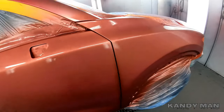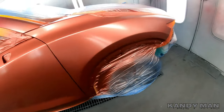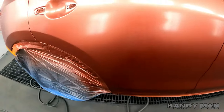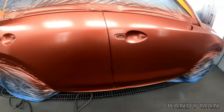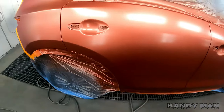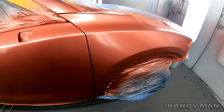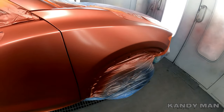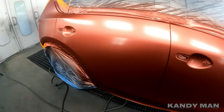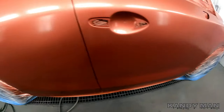It's not as crucial as a real UK candy but it will have the same characteristics if you get a little crazy with the gun. We got to walk this one out. Let it flash and we'll see where we're at. I'm using the 3M gun with a 1.2 in it for the ground coat — we put two back-to-back coats on it, checked it with the light, and it's covered. So we're going to go ahead and do a drop coat, and then an orientation coat to get it all even.